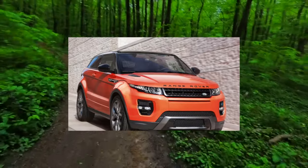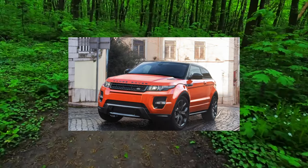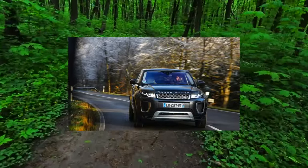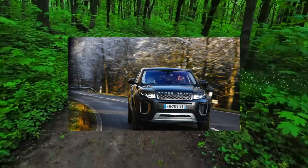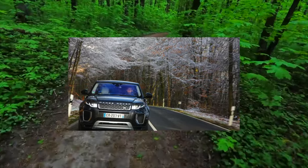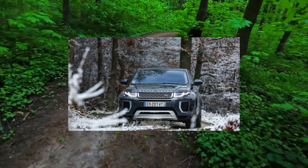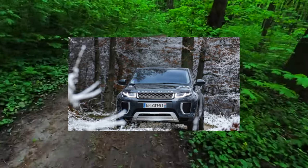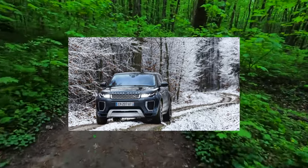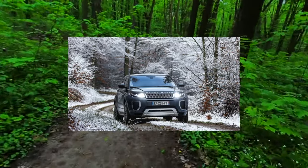The traditional Aisin bevel gear problem with corrosion and spline wear is minimal on the Evoque. The high cost of drives and lack of lubrication in the outer CV joints after hundreds of thousands of kilometers means it is better to replace the lubricant. A Ford 6-speed Getrag M66 was installed on some cars, but it is difficult to encounter such an instance, so there are almost no statistics. On Freelander and other cars it has established itself as a strong middling — after 200,000 miles you usually need to be ready for bearing replacements and overhauls. Spare parts for this manual are more expensive than for Aisin, and the box resource is less. The flywheel here is dual-mass but quite reliable.